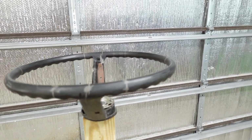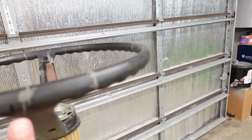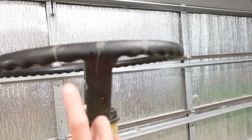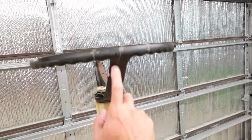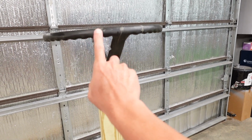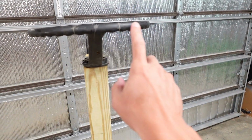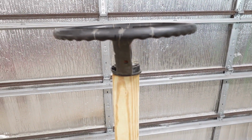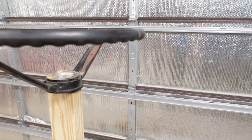Then at that point, you're gonna go through each one of those cracks, and wherever there might be any other minor imperfections... This camera's not great at focusing when it's real close. But wherever there's other minor imperfections, you can fill that in now. JB Weld does sand. I'm not gonna say it's easy, but it's not impossible, especially when you're using maybe a little electronic power sander. It will sand it right back down.